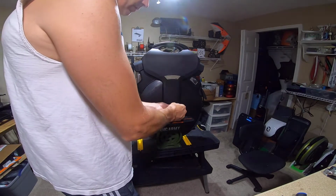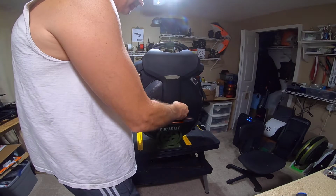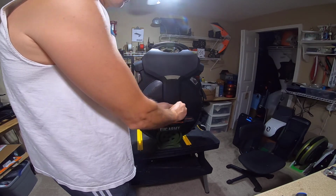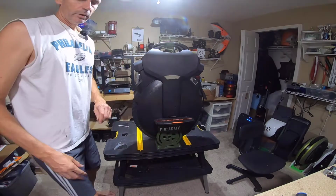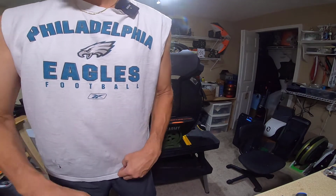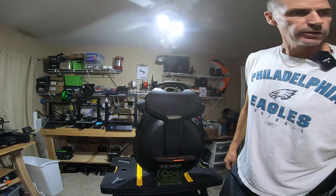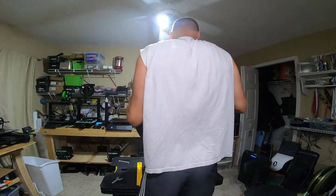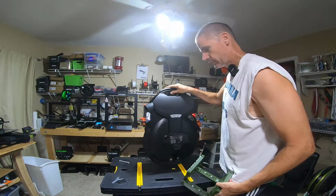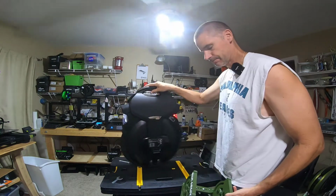According to Inmotion, the top valves, the negative chamber, doesn't need to be messed with much. Their catch-all number that they recommended was around 50 psi. If you had to get in there more often, you could, but it's not all that difficult to do. Okay, there we go, and done. The wheel lives. It still works. That's a wonderful thing.